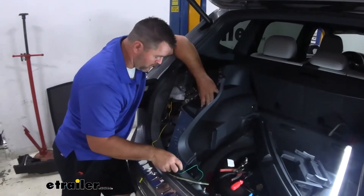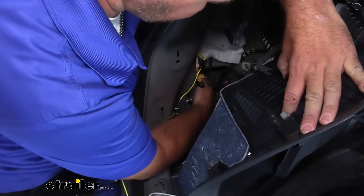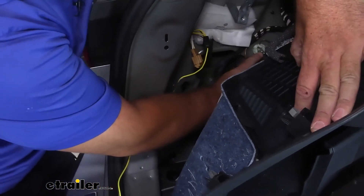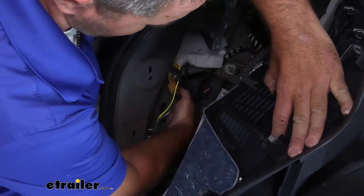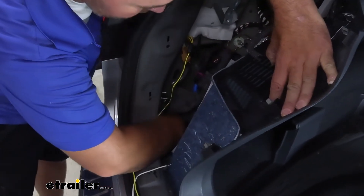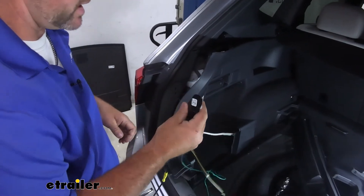What I'm going to do is take my converter box and mount it right back in this little pocket here. It's going to come with some two-sided sticky tape. My ground wire already has a ring terminal on it, and there's a factory ground right here, so I'm going to ground it there. I'll have my box in here, and then I can run my four-pole and my wiring that's going across down through this little opening. Take the two-sided tape that comes in your kit, peel off one side, and stick it on the back of your converter box.